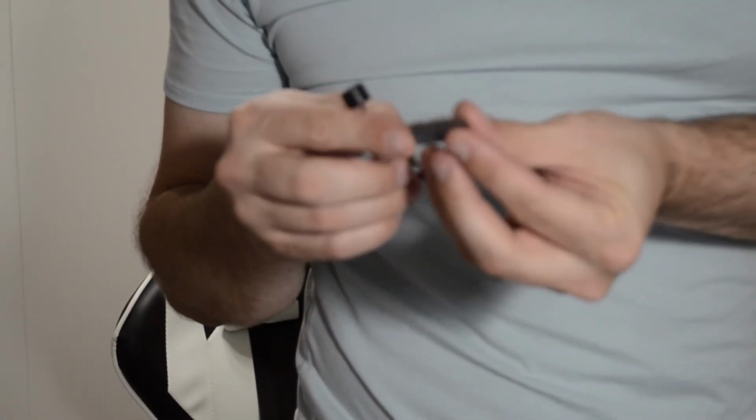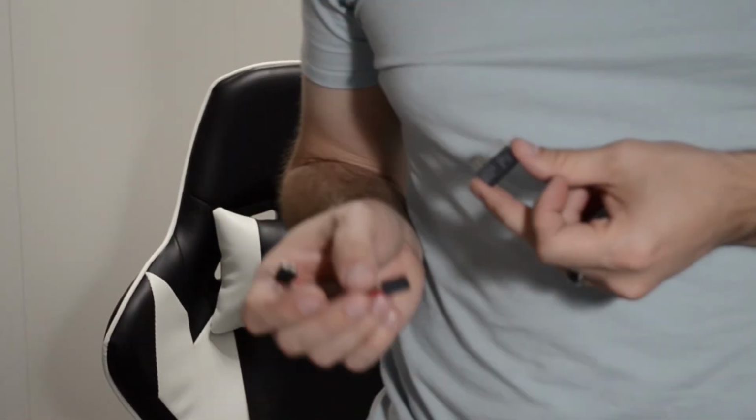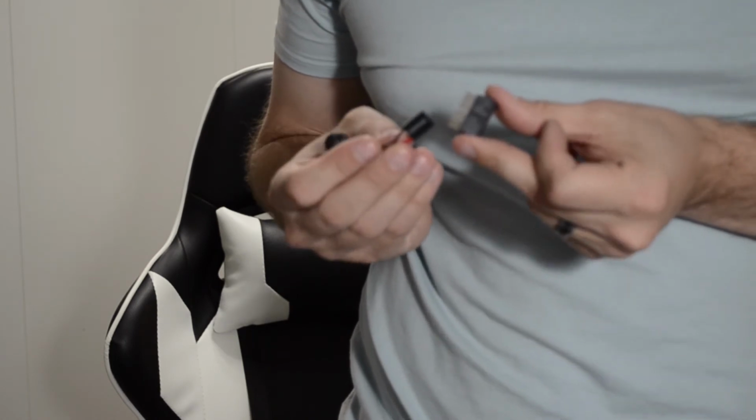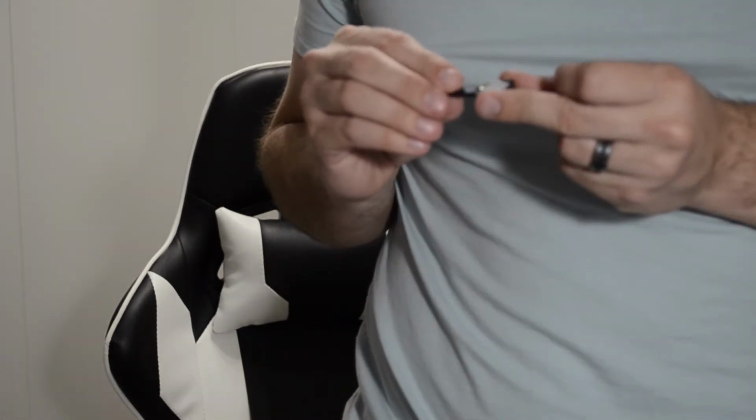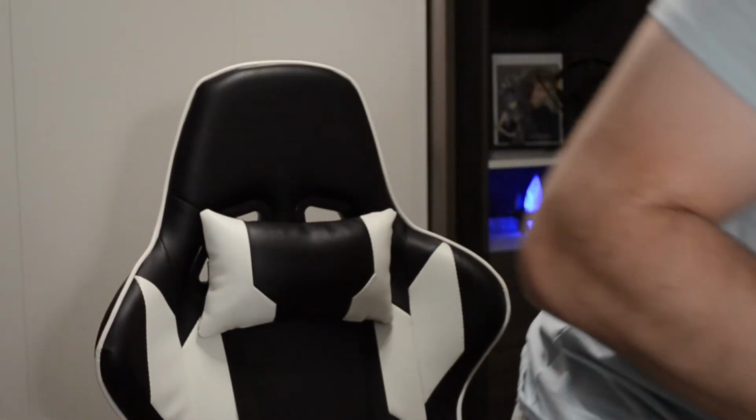For some motherboards, they come with an alarm that's separated. This thing will be connecting to this as well. There are a few motherboards though where this is actually built into it and you don't have to worry about it. I'm going to go ahead and connect that for you guys. So first things first, we have the speaker. We're just going to look on this little panel and find the speaker. So we're just going to line it up and connect it. Just like that. It's connected, and now let's do the cables over here.